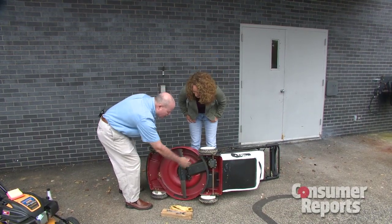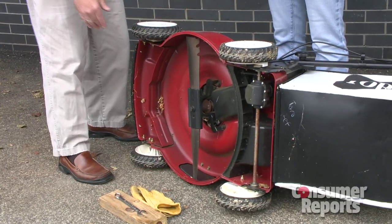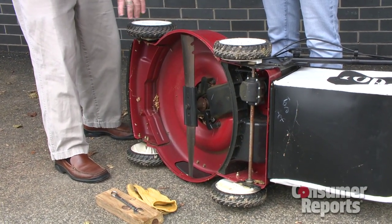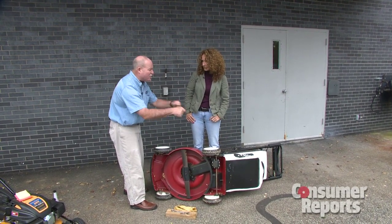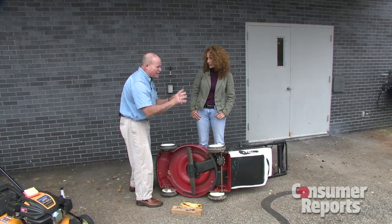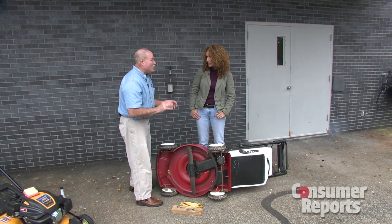Normally, there's a built-up mess of clippings, and the problem is that clippings hold moisture against the deck. The biggest reason people throw away a mower is not the engine — it's that the deck rusts. Those clippings, if you leave them, promote rust and corrosion. And if you leave them and mow in spring, the airflow and currents don't work right, so instead of proper mulching or bagging, you get clumps and uneven mowing even on a mower that would normally do well.